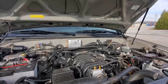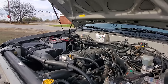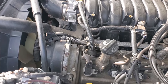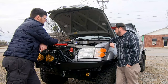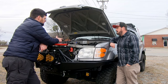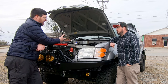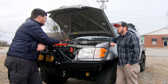On the inside this looks a little different than stock. This truck was supercharged originally, but there's not a lot of aftermarket support for cracking the ECU to tune it. So I pulled the supercharger. It's the 2UZ 4.7 engine with long-tube headers, full custom exhaust, and high-flow cats. It's also got a dual-length runner intake that comes off an 05-07 VVT-i 2UZ — it's vacuum-actuated, which gives better throttle response, better low-end torque, and a better high-RPM range.